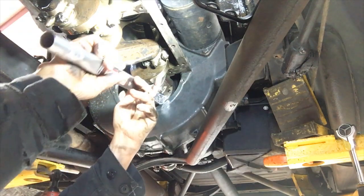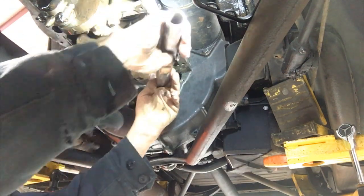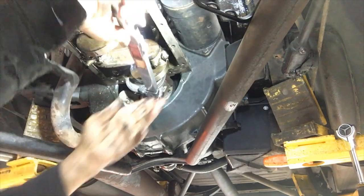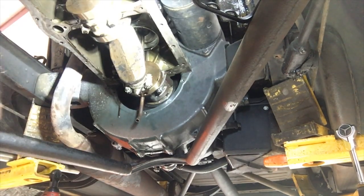There's some torque on it now. And one other thing — I do the rods the same way. Just take the rods down and pull shims out until you can tell it's got pretty good drag or won't turn, then put one shim back in and turn it, and then you've got the proper clearance.